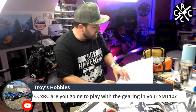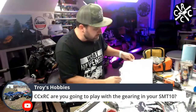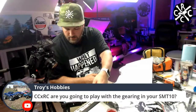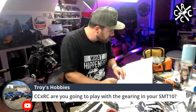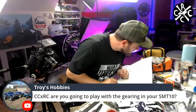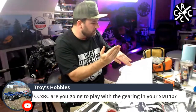Josh Rhodes, is that going to cause me some trouble down the line, not having them be in line? I know with drive shafts, you want to have them phased right. Doesn't look like they have them phased when they show it in the directions here. One of theirs is this way and the other one's up. So,